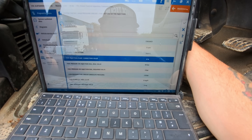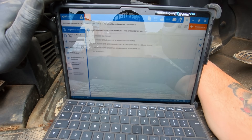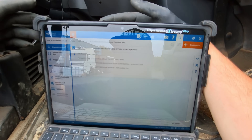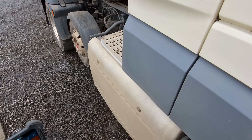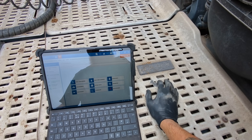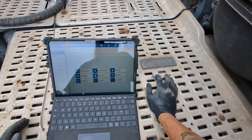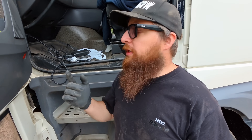From that test we were doing 45 percent more than we should have been. Our low fuel system pressure isn't keeping up with the high pressure system. It doesn't mention injectors or high pressure pumps - all it says is fuel pressure data valid but below normal operating range. With such a high correctional value we'll be looking at possibly injectors, fuel pressure control valve, and high pressure unit pumps. Unfortunately the driver is waiting and needs to go, so we'll get the equipment out and do the high pressure test next week.